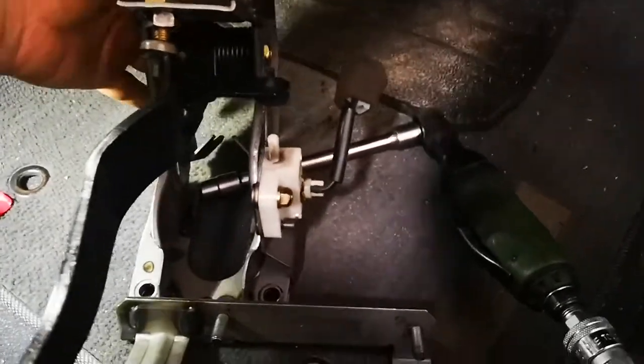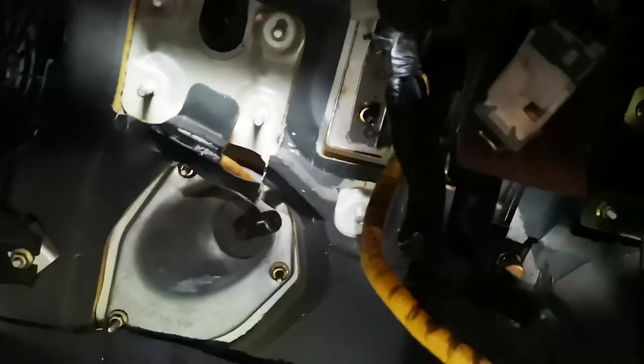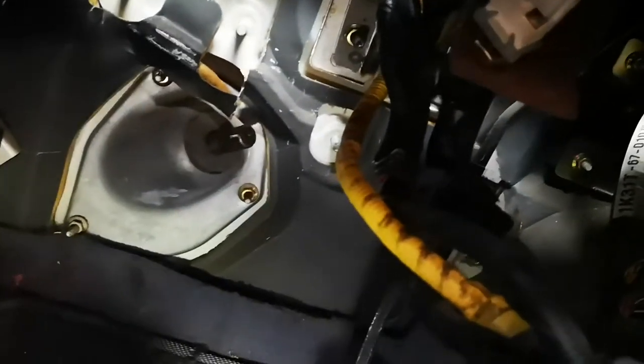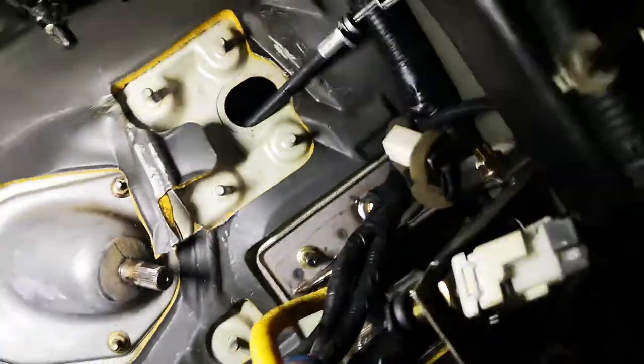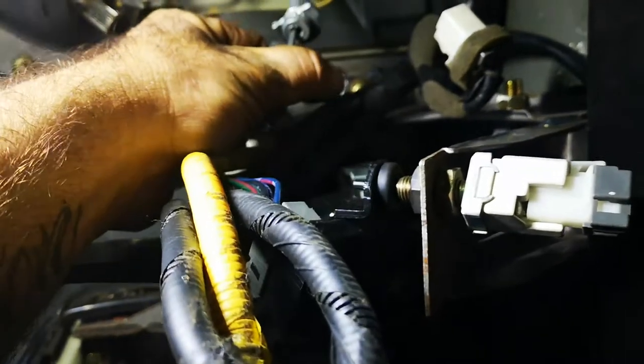While you're doing that, obviously you have to disconnect the clutch cable from the hook on top. There it is — that's where the clutch cable sits. What you need to do is loosen your clutch cable on your gearbox entirely. In this case, the clutch cable is damaged. There it is — it's sheared off as well, sheared off there.